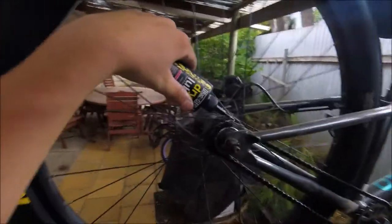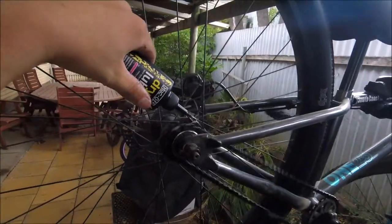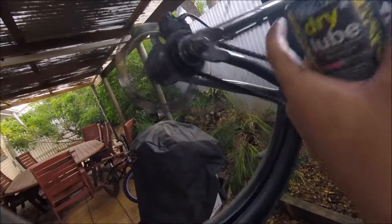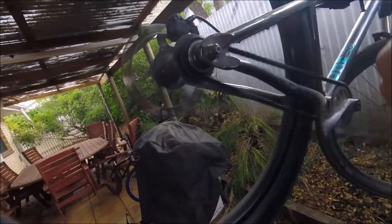The chain's all clean now. We're gonna go get the Muck Off dry lube — that's what we use, it's good stuff. You're just gonna hold it over your sprocket or the chain and apply it per link. Work it in a bit, and if you have gears, change through them so you can get the lube into every one of your cassette teeth.